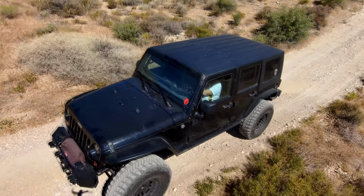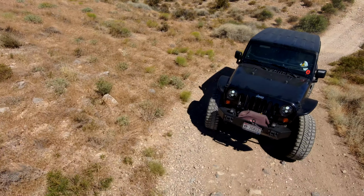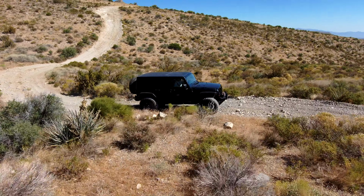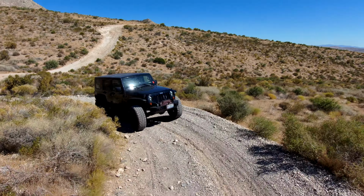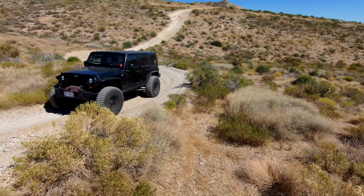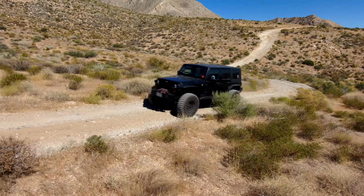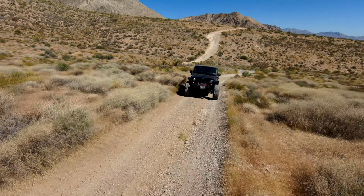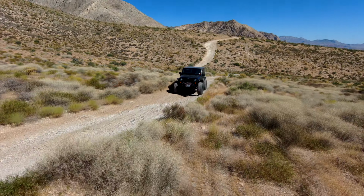And we would put giant cams in them, and some of them we'd put roller cams in, and that would stabilize the idle a little bit. They were still blowing massive amounts of hydrocarbons. So they really weren't what I would consider the ultimate daily driver. But they sounded mean, and they were fast and all that. But today you can pretty much get that same level of performance with an LT and perfect drivability.